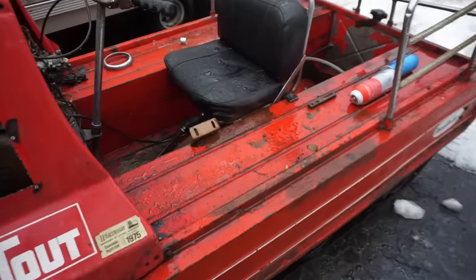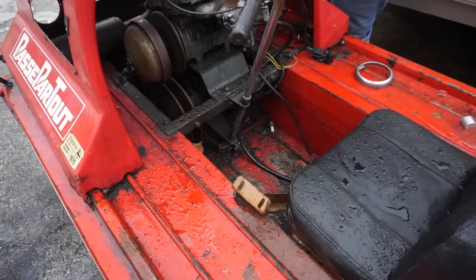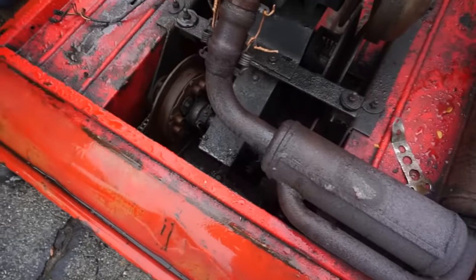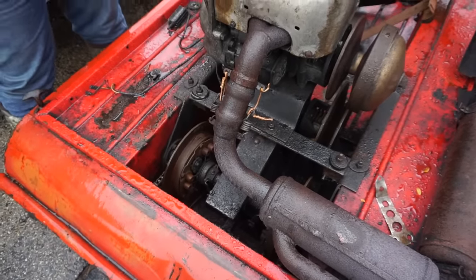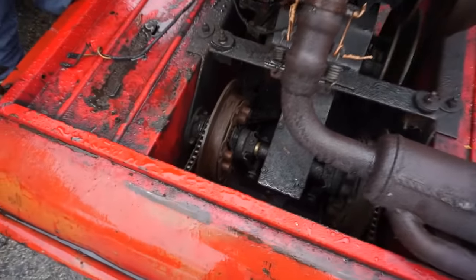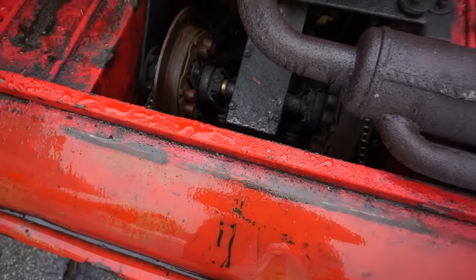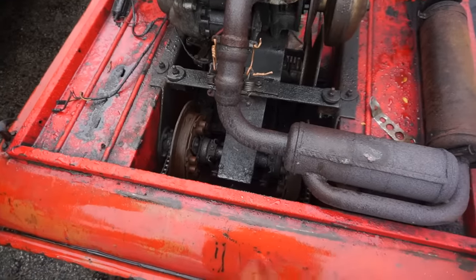So how does this thing steer then? So you got your tillers, which run two actuating rods that run along the bottom. You open this up. Yeah, that's interesting. These are two car clutches. I was told Volkswagen, but I also heard Renault. But basically what you do is when you push it, it depresses your clutch and hits the brake if you steer hard enough. And it'll lock the one track and pivot on it.